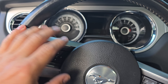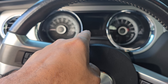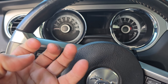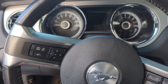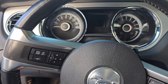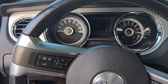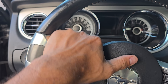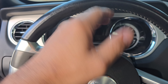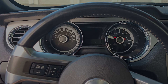I'm going to drive it first to show you how it goes before the tune. You probably won't notice a difference visually, but I'm going to show trans temps to make sure they aren't going crazy. I'll do a roll - hear, feel, listen to where it's locking. I also have the Draggy. I might do a 60 to 130 or an eighth mile hit - eighth mile is smarter so I don't get caught by the cops going 130. I'll see by tweaking the torque converter if it's a better driving experience.